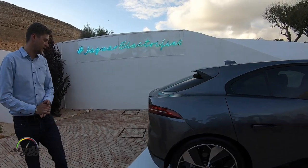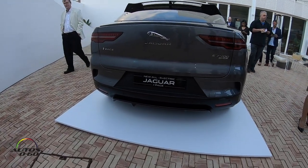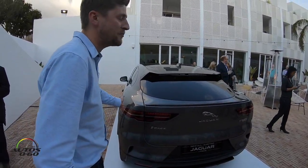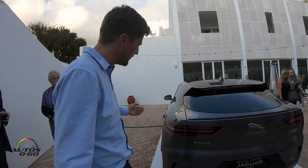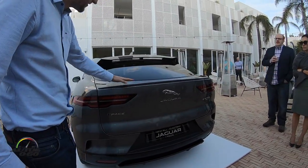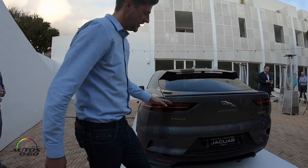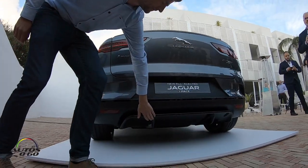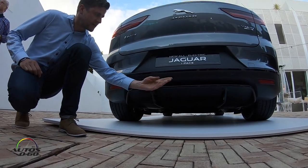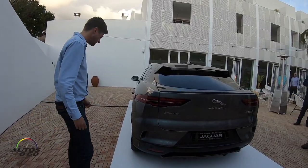Going around to the rear — this is my favorite part of the car. It's quite a square, boxy back end compared to most of our cars. A tapering rear section is not very good for aerodynamics; you need a hard, sharp crease or edge at the rear so the air flows off cleanly in one area without turbulence. That's why we have an active diffuser. The floor of this car is very flat, and the air rushes underneath and joins with the air coming over the cabin for minimal turbulence.